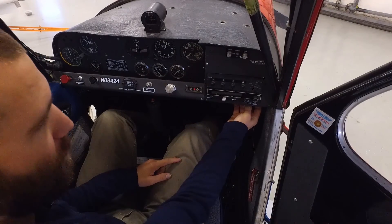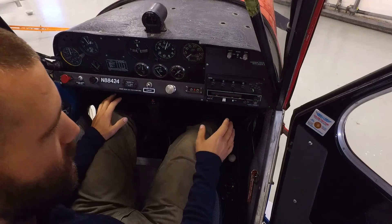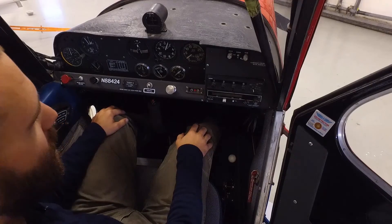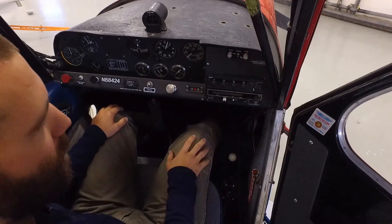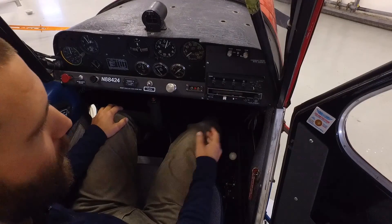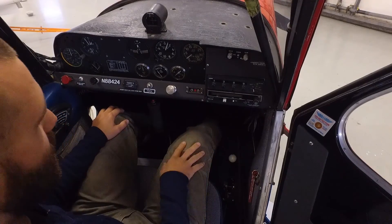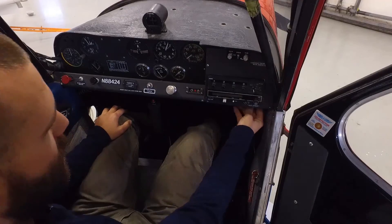I'm not a big fan of parking brakes. I prefer that when we're operating the aircraft and the pilot is in the controls, we use the toe brakes on the pedals. When you're not in the aircraft, the airplane should be chocked every single time — even in our hangar, we still chock our airplanes. There's a slight grade on the floor, and it's better to make sure the aircraft cannot move and bump into another aircraft or get blown around. The reason I don't like that parking brake is it's just one more failure point — guys have been known to try to take off with it on and set wheel pants on fire or tip them over. The parking brake is useful if it's been sitting for a long time, but generally we just like to chock it.